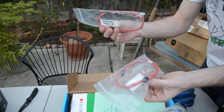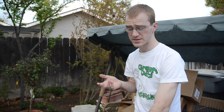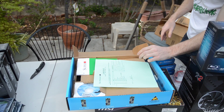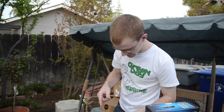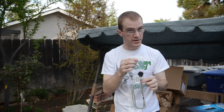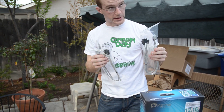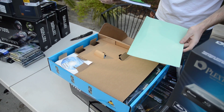Over here we have some regular plain vanilla red SATA cables. As you may know, the C600 series chipsets are very similar to X79 — it's not like the old generation where the 5500 and 5520 were completely separate chipsets from the X58. The X79's SATA limitation of 2x SATA 3 and 4x SATA 2 is still present on this board. The C606 boards do have SAS, so you get 4 SATA 2 — which was supposed to be SATA 3. Intel continues to prove they cannot make the 6 Gbps storage portion of their chipset work well, so we get 12x SATA 2 and 2x SATA 3 from this board if you use both SAS cables and the onboard SATA.